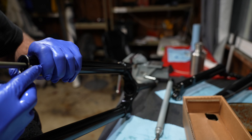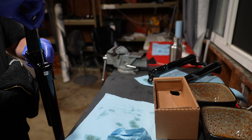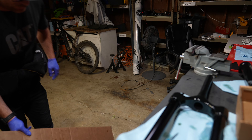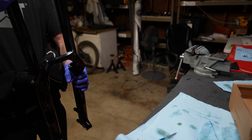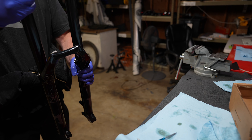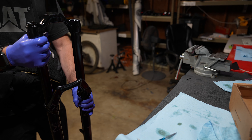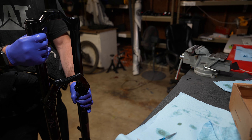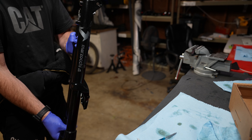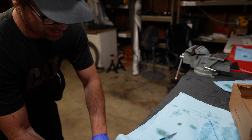While I was putting this fork back together — which is precisely the same as the Fox 36 Rhythm and the old Z1 — I did discover one massive improvement for the new Z1. When I was putting the lower legs back together, I was like, wow, that was really smooth. Basically one of the massive improvements for 2024 is some really, really good bushing tolerances. The fork feels like butter. I have no plans of ever buying or riding a Z2 fork, but let me know what you think about the damping and how that fork rides if you have one.